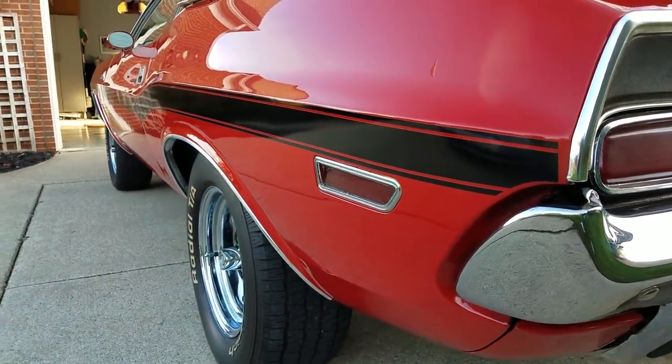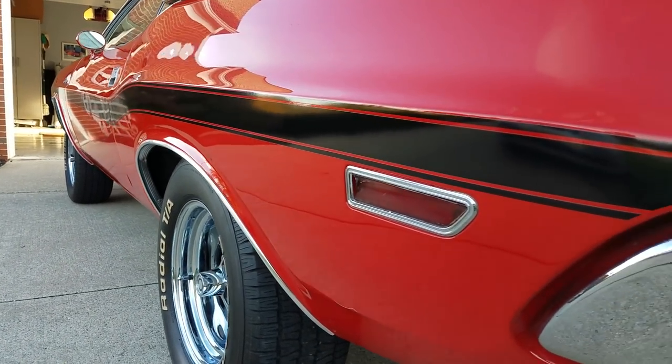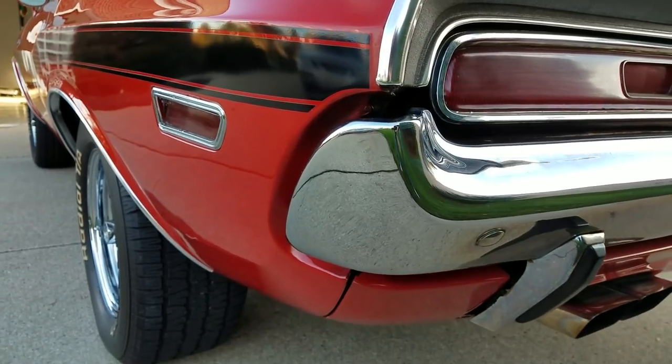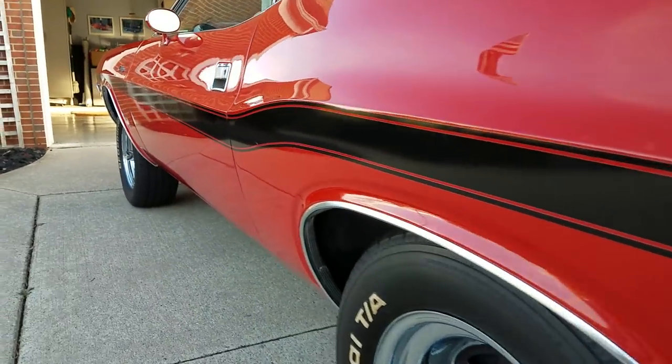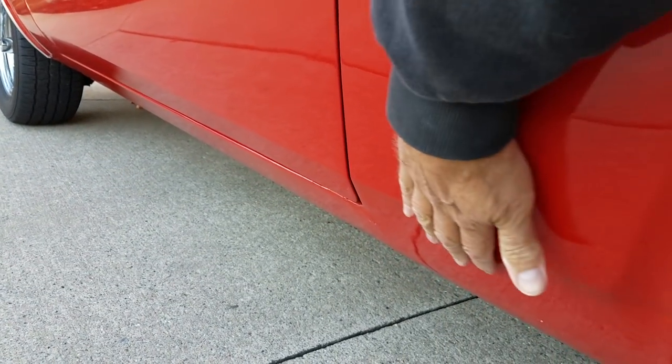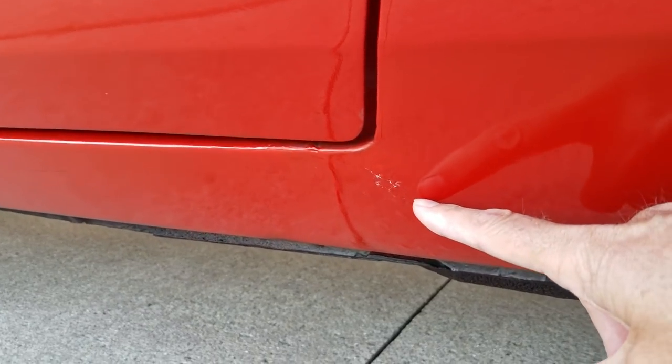Sticking them onto the body while we're here — the car shoots nice and straight down. At a general glance it looks good. Wheel opening moldings fit nicely. Tail panel fits nicely. Down here in the quarter dogleg, there's a little bit of waving going on. Some bubbling here and there in that quarter panel overlap seam.